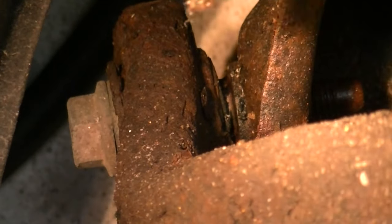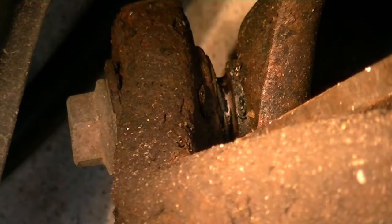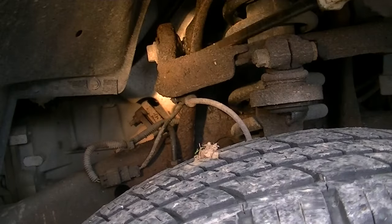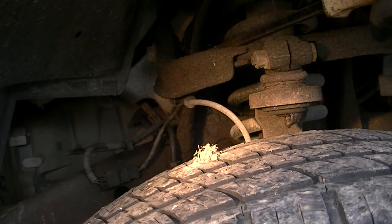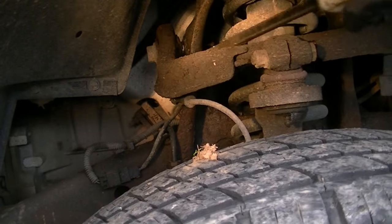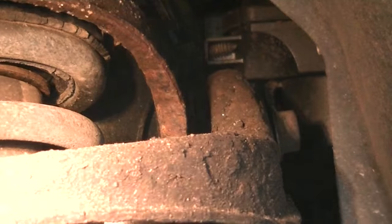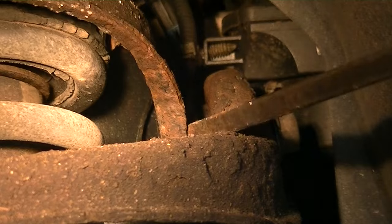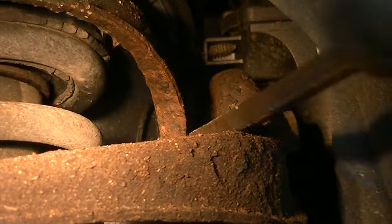Now, this bushing here is the back one on the passenger side. And if I pan back out here while I'm shaking this, you can see this tire actually moving. So now I'm going to pry on this — watch the top of this tire as I shake this. Check that tire out there, see it moving? So I have found my problem right there. Now here is the front one. If I put a screwdriver in here and just kind of pry — check this out — there's a half inch of movement there. That is crazy.